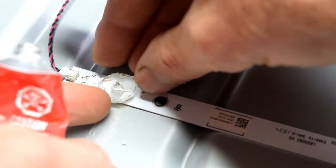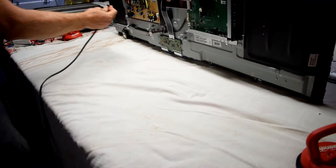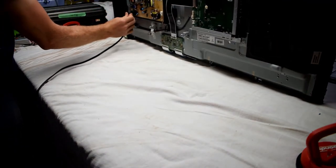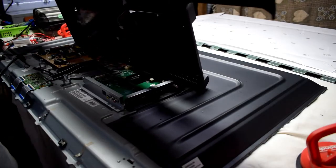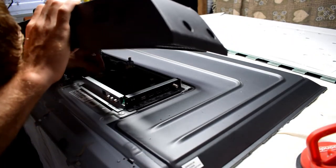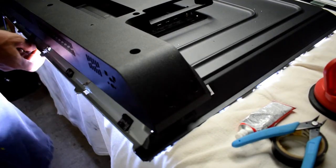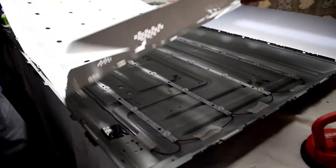Using some shoe glue, I'm gluing back the filter on top of that LED — that disperses the light so it's evenly on your screen. Then we want to verify that everything's working before you put it together. Just plug in the power cord, then reconnect the power button — that's the little cable that we first disconnected — and see if the lights turn on. You can see the bright lights are on and everything's working, verifying that the backlights are repaired.